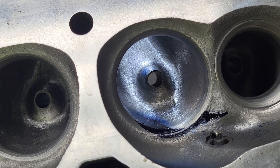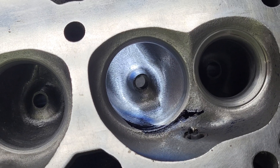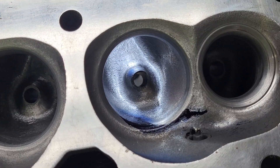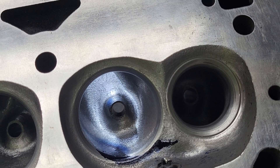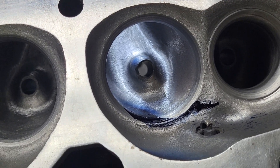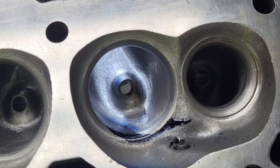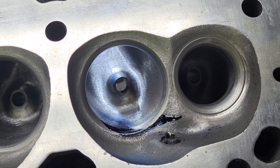The customer asked: maybe we should upgrade the valve sizes at that point. It's more work, but these heads are quite impressive as they are. I don't remember ever making a 194 head that did what these do. At a 202 they'd be almost identical to another set of Darts I did a couple years ago — those flow 275 but with a bigger valve and probably a bigger port. Give me your opinions on going to a bigger valve on these.